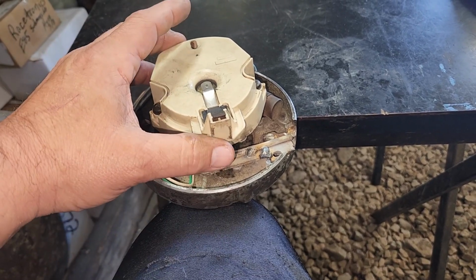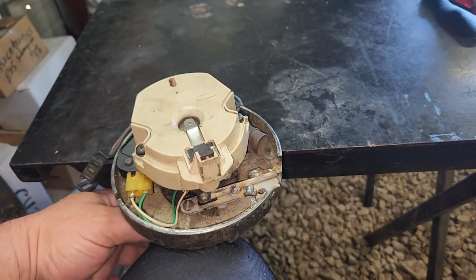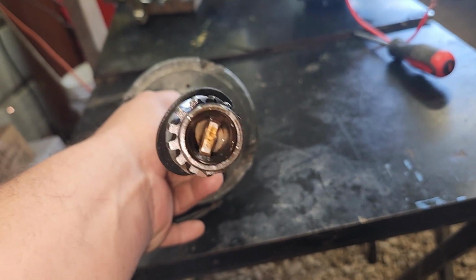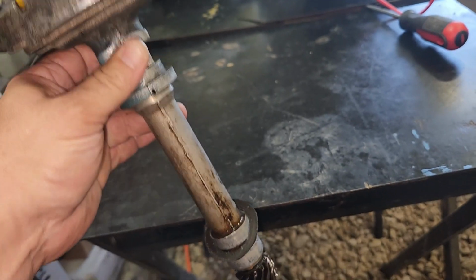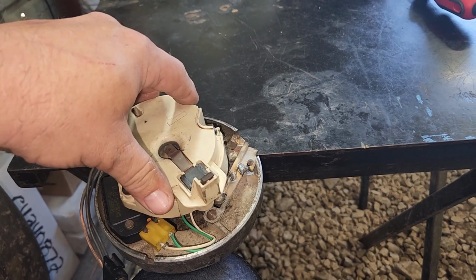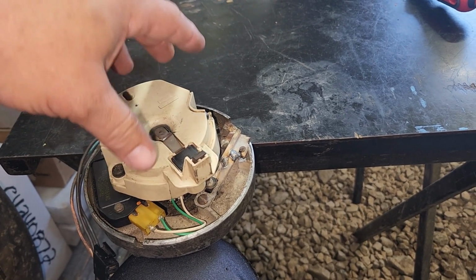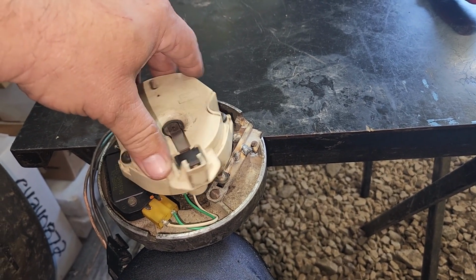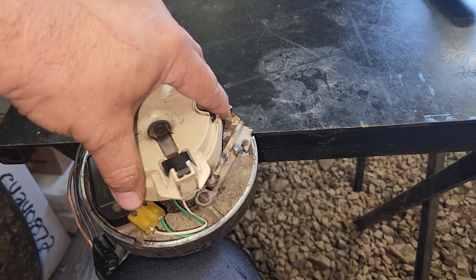So what we'll do is once we get it stabbed and all the way down, and you might have to do this a few times because when you put the distributor in, sometimes it don't fall all the way in because that hits the oil pump drive. That's got to go down in that groove of the oil pump drive or the distributor won't fall all the way down. Just keep a note on small block Chevy, when it drops down, it's going to twist this way some. So if it ain't going all the way down, point it at like number 3 cylinder. That way, when it goes all the way down, it turns this way as it goes down. When you put it in, you stab it, and as you push it down, it goes like this.